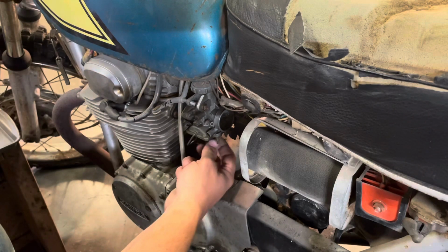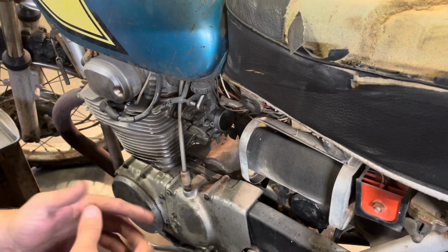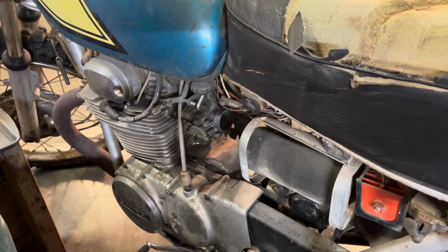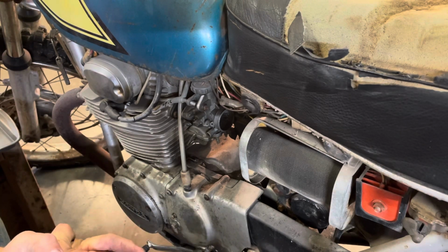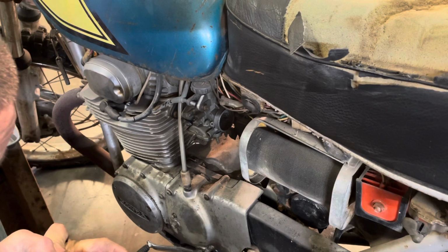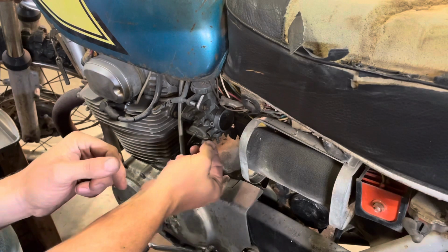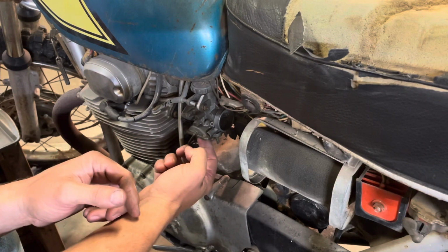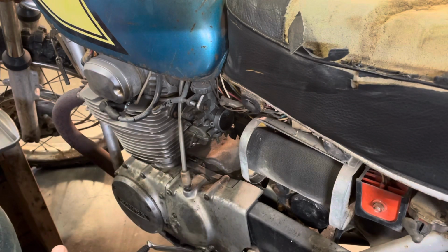I think what I'm gonna do is spray the bottom of this with brake cleaner. I'll move you around to the other side and we'll pop the bottom of the other one off, and I'll spray brake cleaner up in there. That didn't have much in it, so I would assume it's probably good enough at least to see if it'll kick over and fill up with fuel. I'm sure these dried up gaskets will be leaking like crazy, but I just wanna see if it would run.